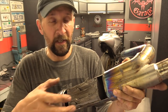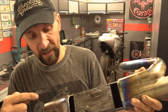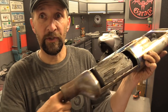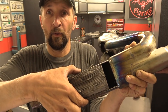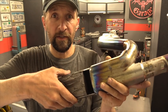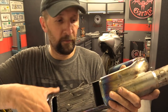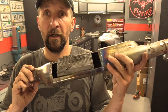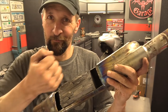It's just a case of ripping all that out and clearing it all away — you don't want any nasty little bits left in there. You can see quite easily that those who choose to put a drill bit in there and just drill through it are only going to remove a bit at the top — they're not going to take all of it out, and it is properly packed in there. They make this item by probably rolling it up and pressing it inside a tube, then welding it in between. It's a pretty simple bit of manufacture, and a pretty simple bit of de-manufacture — so let's rip that out. This is the fun bit.